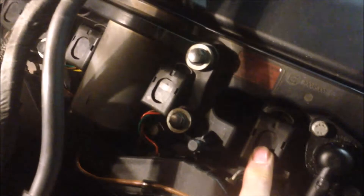Now we have got the cover off. The spark plug is just under the coil, so we take the coil first. To remove the coil, you remove the wiring plug first — lifting this up. So this plug will be squeezed out, just remove the plug.